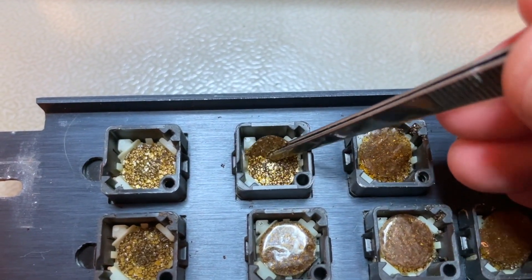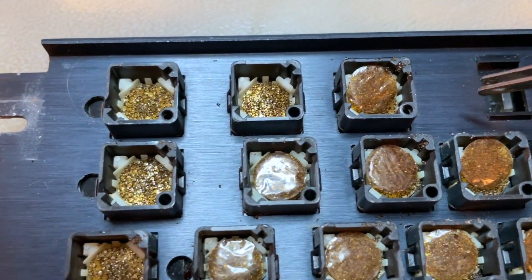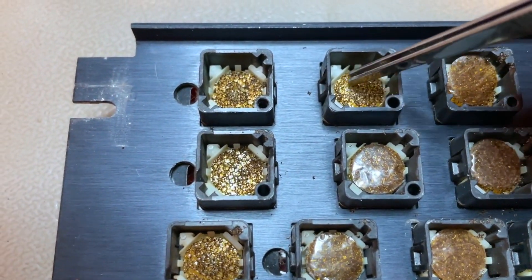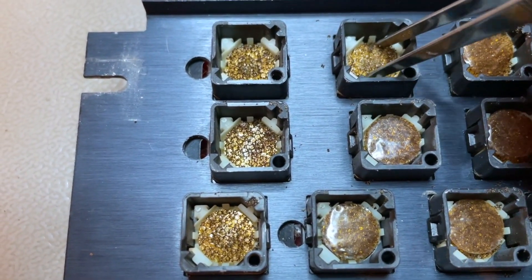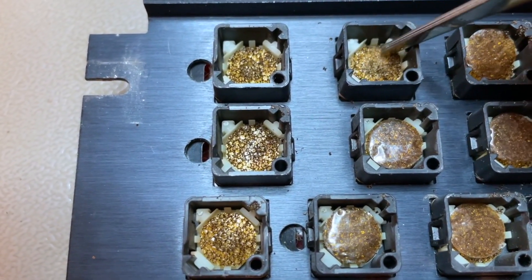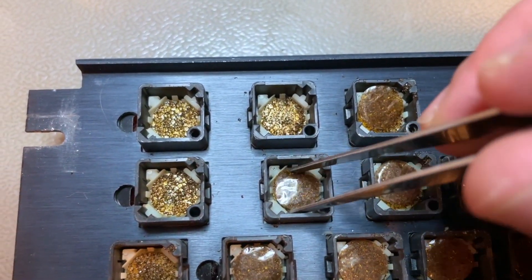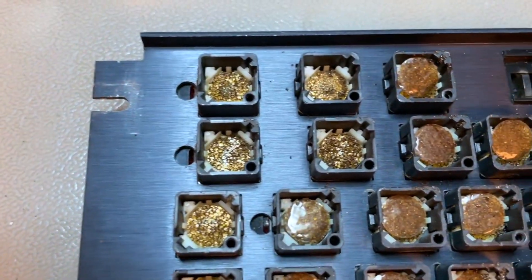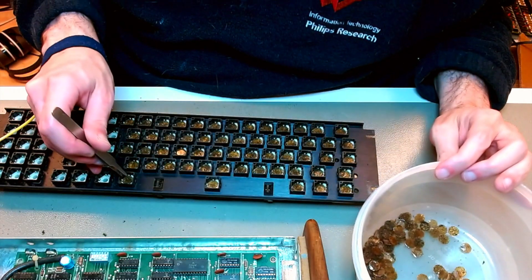Look — that's the top foil, it contacts the pads. And in between that and the bottom there should be five millimeters of foam, but it's dried out. It's basically gone — it melted away and then dried out. I have to remove everything that remains there, including the top and bottom pads, then clean the keyboard and replace these foam pads completely.